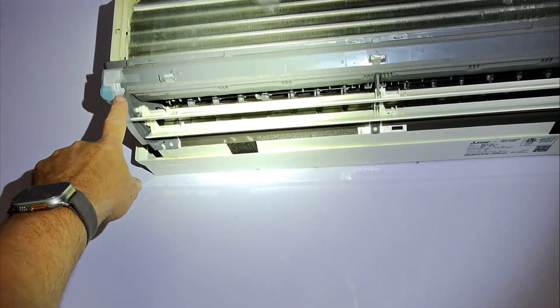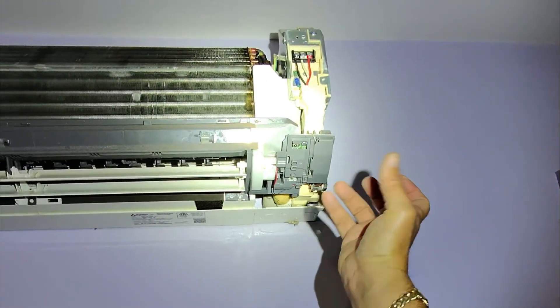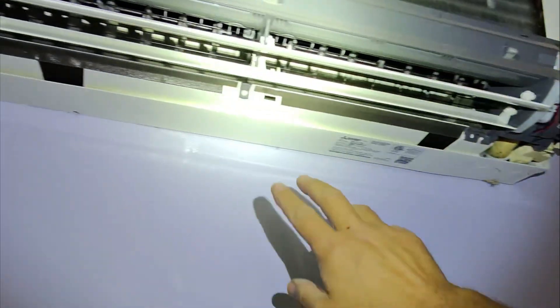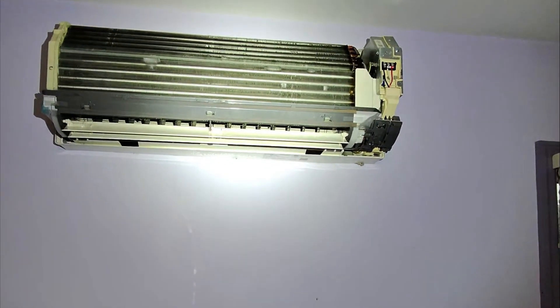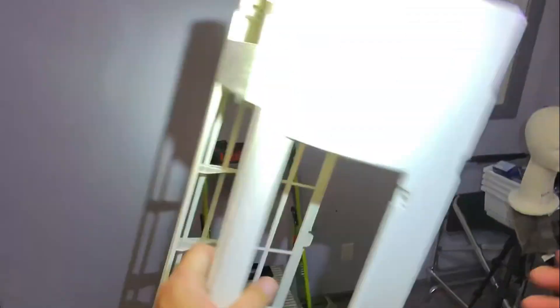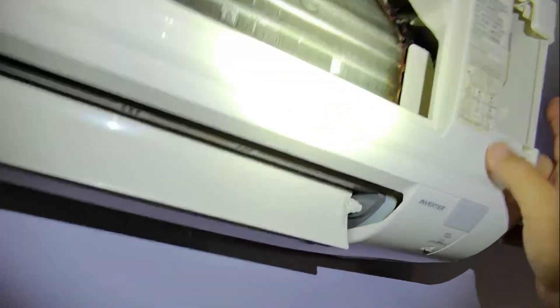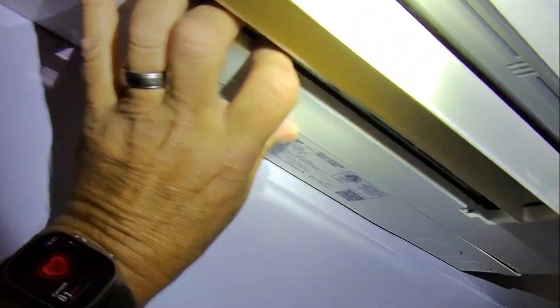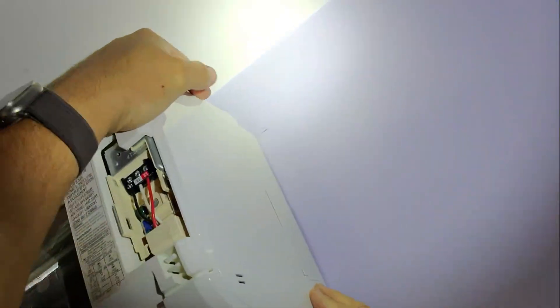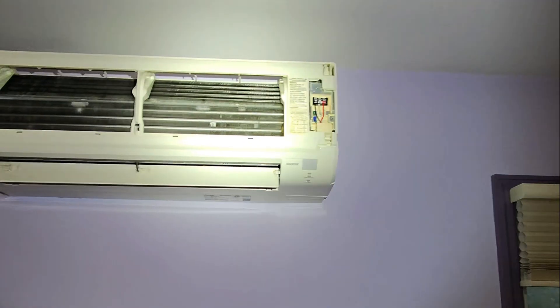All right, we have the drip pan back in place, the louvers and the motor assembly control hinged back in. It was a little bit of a struggle — I focused my attention on getting this piece in first and then the other two snapped into place. It took me about three or four attempts, but now we're in there. The plastic cover is nice and clean — very nice. Looks like our top piece is being a little stubborn — there we go, excellent. Put those screws back in, put the filters in place, electrical cover back on, restore power and test fire.